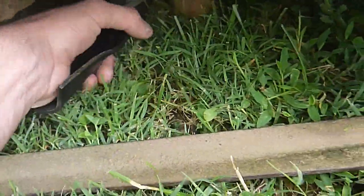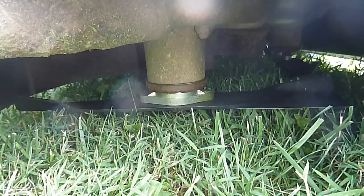It is a three-blade setup with very small blades. It's a metric deck but approximately a 40-inch cut. Most of these had a timed deck so the blades would actually overlap and had to be timed so they didn't hit each other. There was a shear key in each side of the blade adapter — that's six shear keys at $3.99 apiece — and if you hit something you'd shear all six keys, which got expensive. I'm glad this one doesn't have that deck. It still leaves a real nice cut and I think that'll be better for the longevity of ownership.